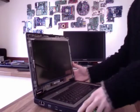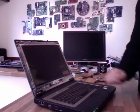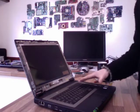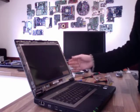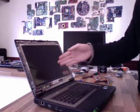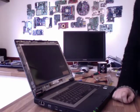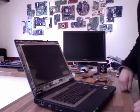The other case can be if you're fixing a Dell laptop. Dell laptops have very strange brightness controls, I've found. A lot of the time, if you get a generic panel that's not specifically for your Dell laptop, you might find that the brightness control doesn't work properly. Out of, say, 5 brightness settings, it starts on low, it gets brighter, and it gets slightly brighter. Then all of a sudden, when you go to the next stage, it gets dim again. There's nothing you can do about this. It's just the wrong panel. I've fought against this before, and the only thing you can do is just admit that you've got the wrong panel and get another one.